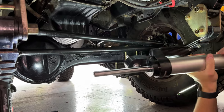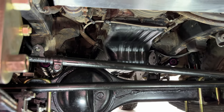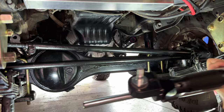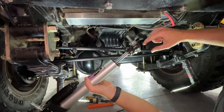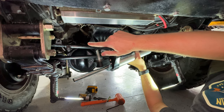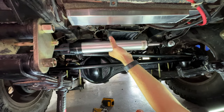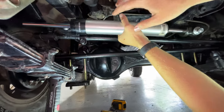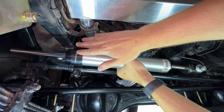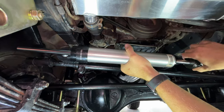So this is a very simple install. You can see we've got a frame mount and we've got a steering linkage mount — the tie rod or drag link. Basically we've got two mounts, a couple of nuts to put on here. This stud I already put in. It comes as a separate mount with two rubber bushings — stick that all together, you can do it in either order. We're going to put the reservoir side towards our steering arm because it'll kind of fit all up in there and keep it protected. There are a couple of Allen bolts on the other side we can loosen and rotate if we need to — that's going to move our reservoir. I want to keep it away from this radiator hose. This side won't have much movement up and down, so when we get it to clear stuff we're going to be okay. It's really just a pivot rather than a movement area.